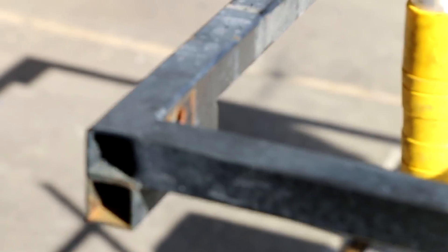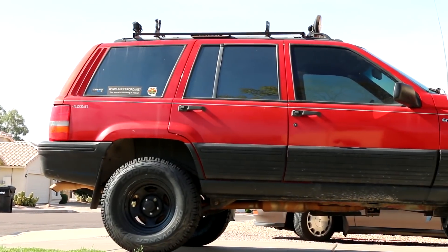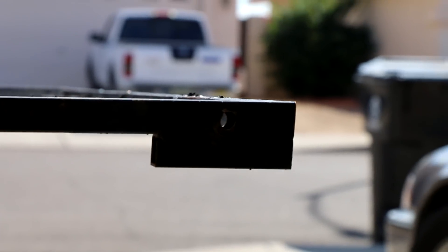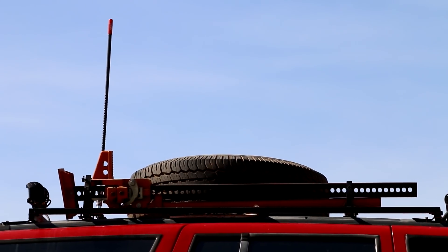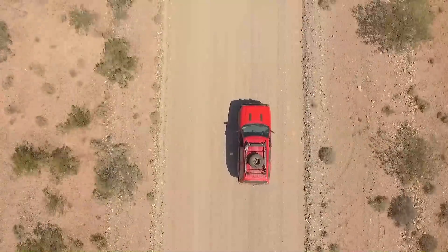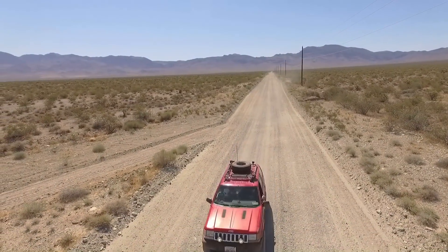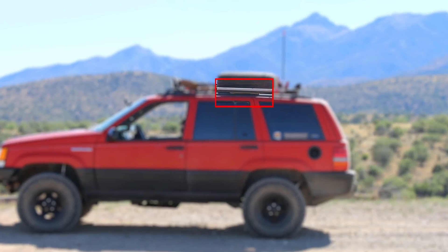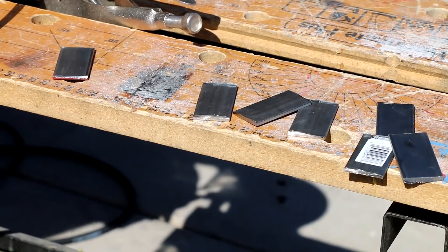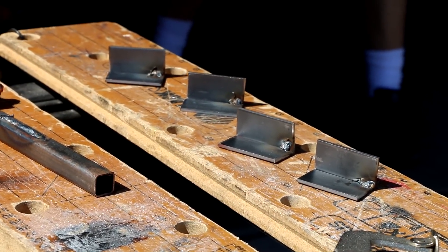The Grand Cherokee has a slightly curved roof and while our rack did sit flat and level, not having mounts in the center portion did cause a slight issue when we first put on the rack back in 2015. We found that under certain vehicle and rack loads the rack would bounce or slightly raise in the center when going over certain bumps. While this wasn't a huge concern and was easily fixed with some foam and tape for lighter loads, we wanted to add additional mounting points to ensure that the rack would not budge, period, under the much heavier load of the tent.